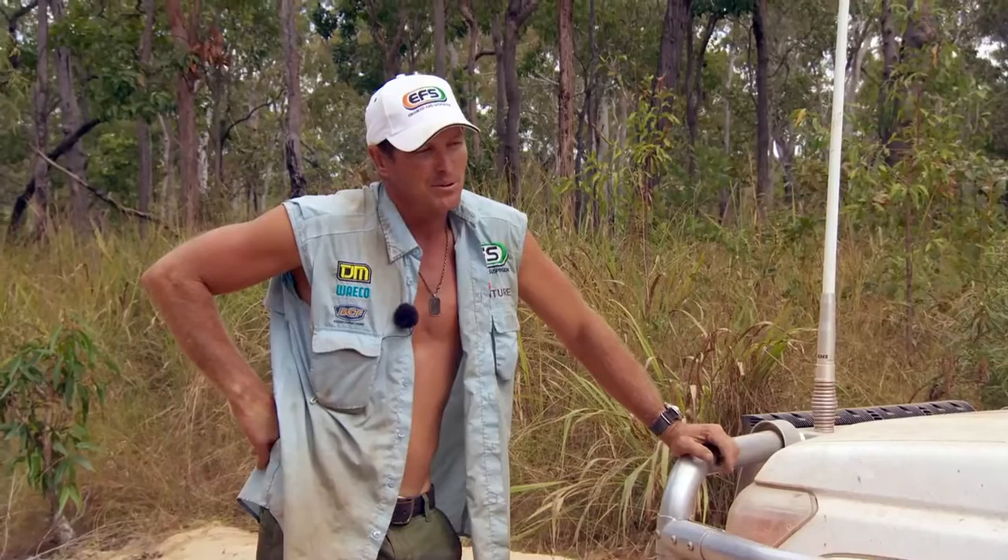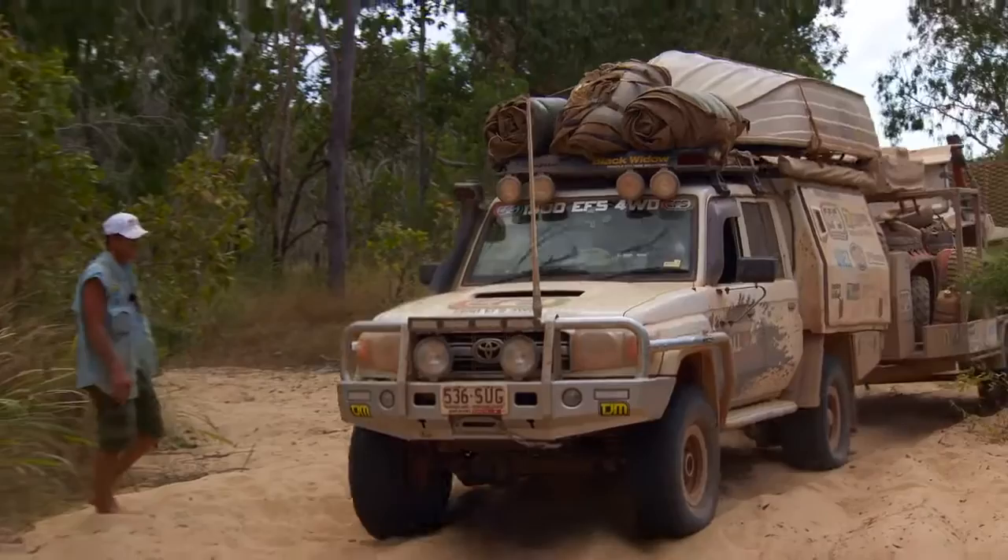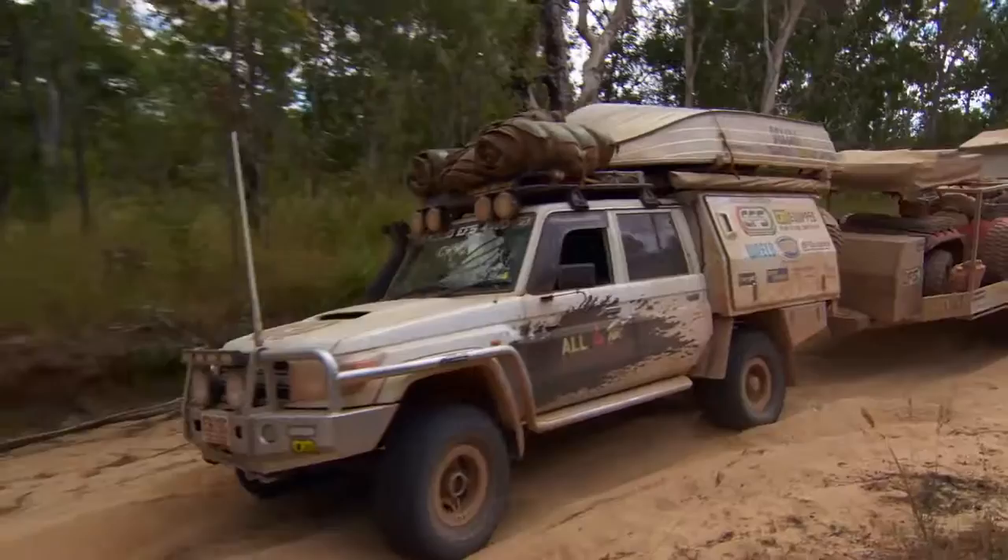The trick is to get the recovery gear out before you get hopelessly bogged. At the moment we're using the Trax as a precaution because I want him to get as much momentum as possible, because once he hits that hollow in there and he's got to crawl out of that and turn, that's where he's going to come unstuck. So he's going to need the tire pressures down, and he's going to need that momentum. And that's where the Trax come along and lift him.